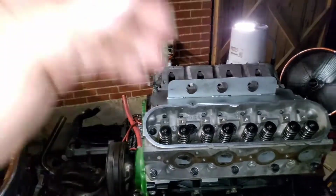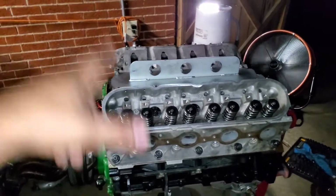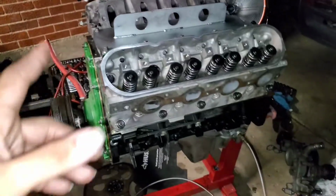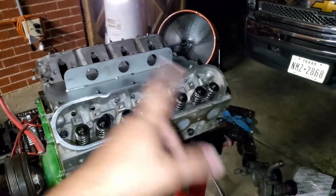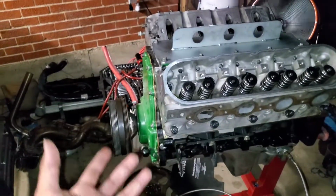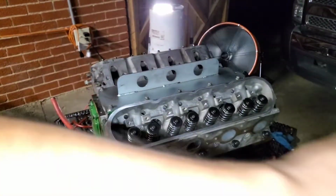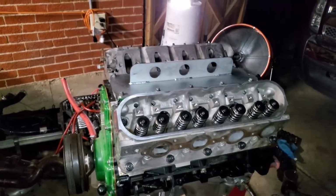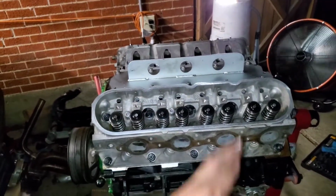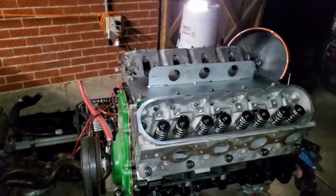And yeah, what I'm gonna do on the first fire up is put some cheap oil in, get the oil up to temperature. I don't know, there's some motor flushes that work with the truck or the oil being warm. There's other ones that like it when it's cold. I'll see which one I get, but I'm gonna get some cheap oil, get a motor flush, flush the whole motor, and then drain it and add some good fresh nice oil, and fingers crossed this thing runs and sounds and idles the way it used to.